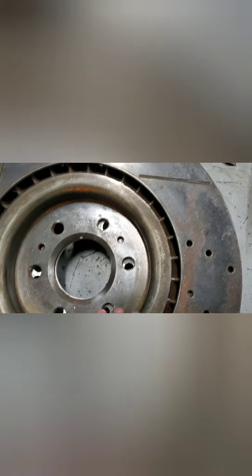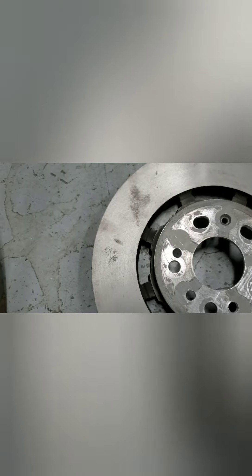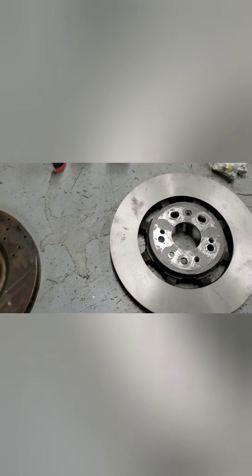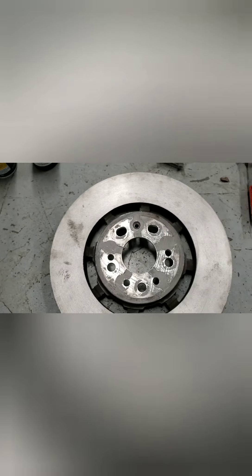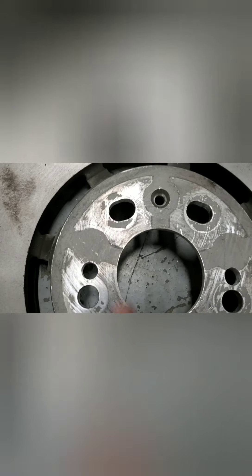Make some marks and drill the six lug holes, but the center hole has to be drilled out using a lathe — I had a machine shop do it. The spec is 70.612mm. Drill that out and it will become hub-centric, so you don't have to worry about the holes being oblong.